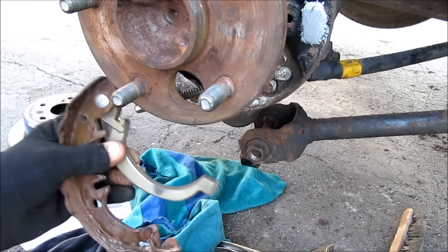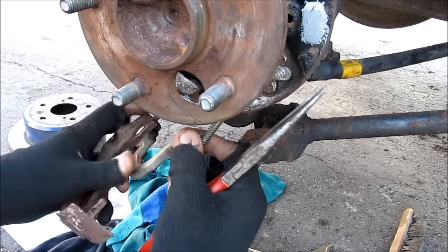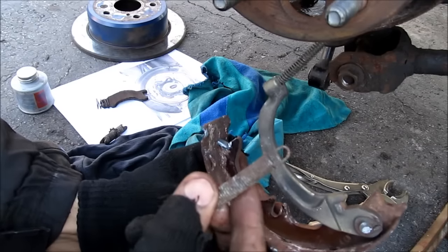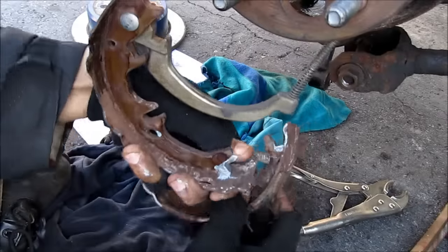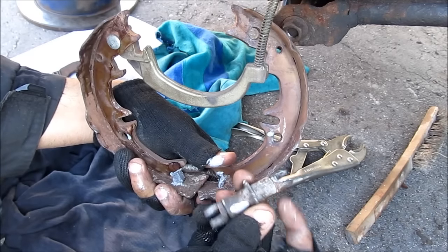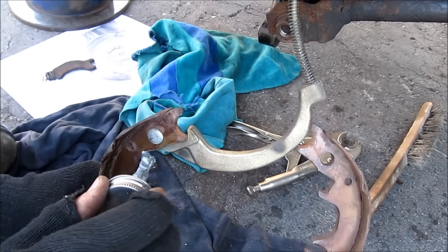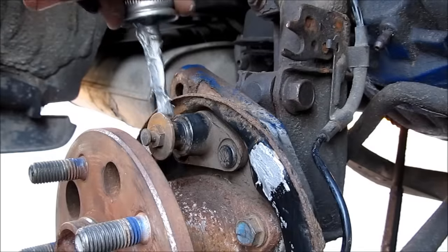Next I'm going to attach the left braking shoe with the parking brake shoe arm to the cable, and apply a little bit of anti-seize in there. Then I'm going to reinstall the return tension spring onto the drums and reinstall the shoe adjusting screw set. A little bit more anti-seize where the shoe strut compression spring goes — on this side and around here.